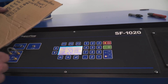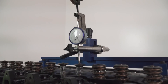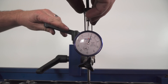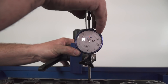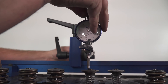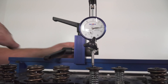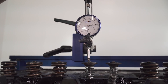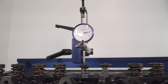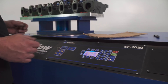So we're on exhaust. Now we're going to move this indicator over onto the exhaust valve and pull this back up to zero. Let's go down to 100 and turn on the exhaust. That's 100 lift on the exhaust valve. This gets really noisy because you get a lot of airflow out of here, but if it blows out your speakers, I apologize.